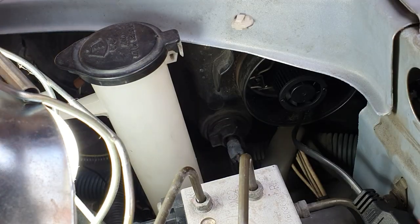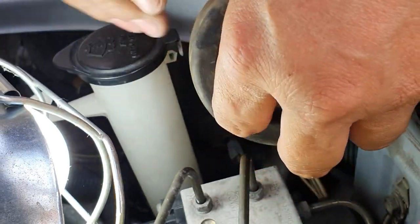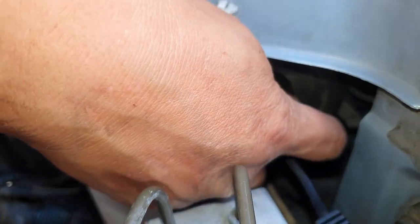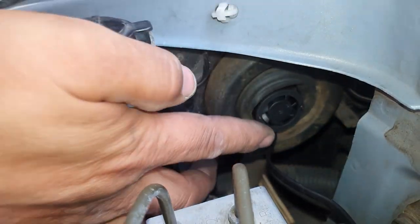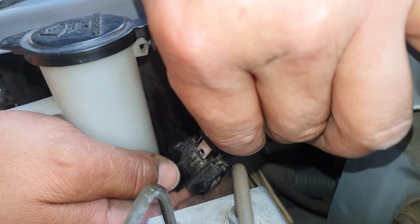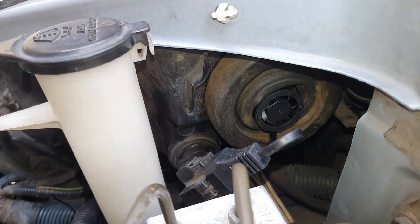After that you just have to reinstall your rubber grommet and plug this back in. In order to plug this back in, feed this cable through like so. Mine accidentally ripped as I was manhandling it a bit too much. All you do now is push the rubber grommet back on around the headlight. Pull this out because you do want it to breathe — you have a fan on the back of your headlight that is going to blow hot air out. Tuck it in around it and leave this part open because that's where the hot air comes out. Connect your connector — match it, line it up, two prongs on the side and the prong at the top, and push it straight in.